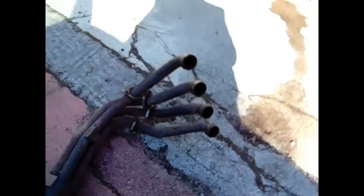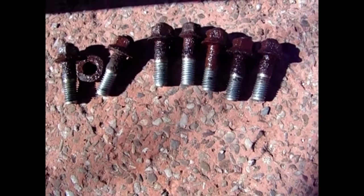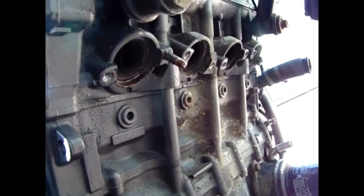Got it off - that was a bit nerve-wracking because they were proper rusty. The nut on number one I had to smack an 11mm socket onto it to get it off. Then the one on number four - the stud's still in. I don't know if that's intentional or just stuck in, but if I can get that one out I'll just buy a brand new set of stainless steel studs for it. I'll have to try and get that one out but I'll do it another day because I've had enough now, I'm going to pack up and go home.